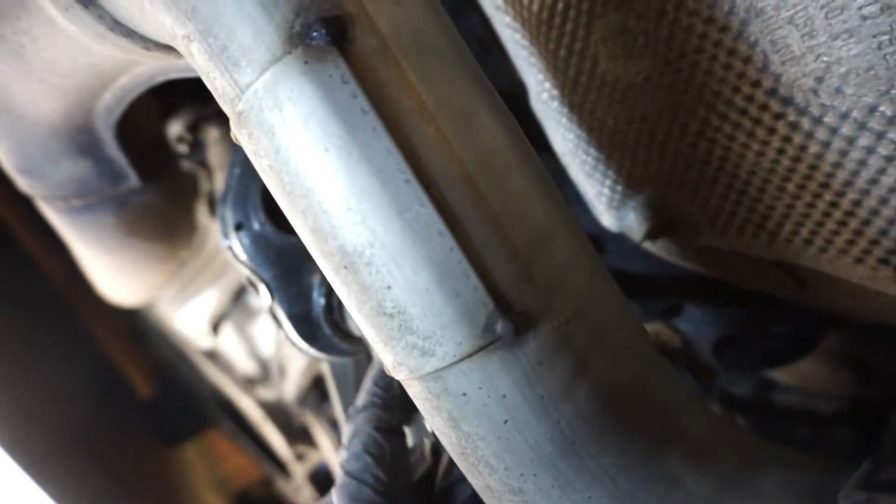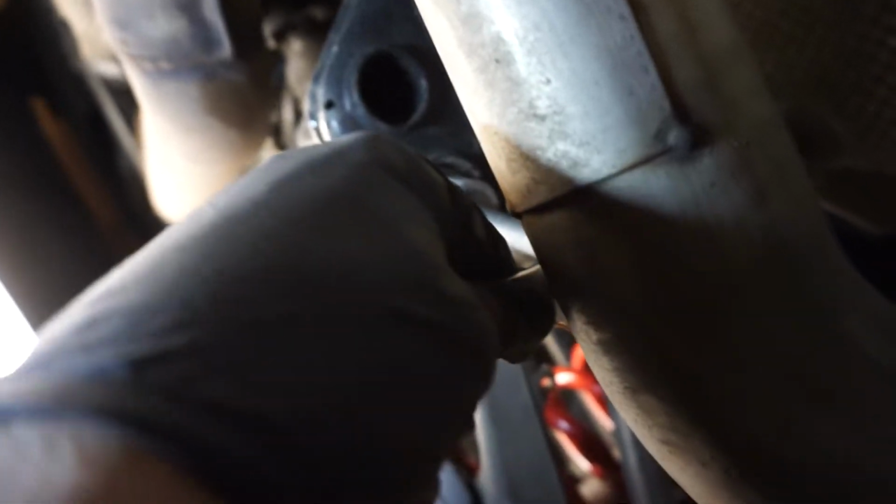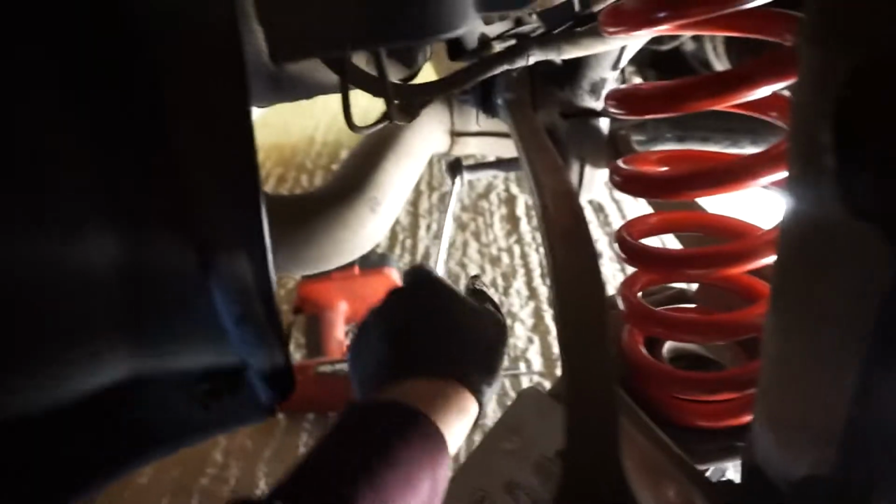Unfortunately, you have the same clearance issues going back in as you did taking it out. So again, I'd recommend getting a 21mm ratchet spanner. Would make this a whole lot easier, because until you've got this about halfway wound in, you are not getting a socket on it. Still going. I think at this rate it might be quicker to actually order a ratchet spanner from Amazon. And then you get to the joyful moment where you can get the socket and ratchet back on it, and progress speeds up a little bit.